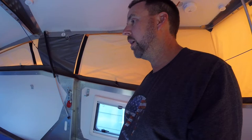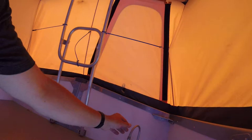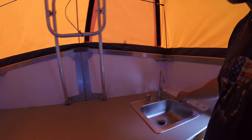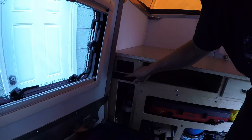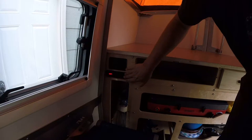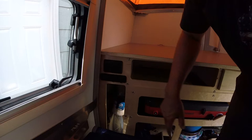Now the unit is up — it took about 20 to 30 seconds to raise it, and I'm standing up inside. I've added the sink with a soap dispenser and a single faucet — no hot water, didn't think we needed it. There are 12-volt outlets, one with a USB phone charger output, and switches to control things. My battery charge is showing 13.7 volts. I have a pump switch — you can hear it activate slightly.